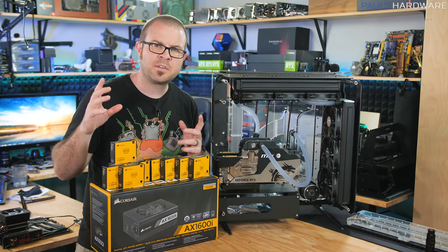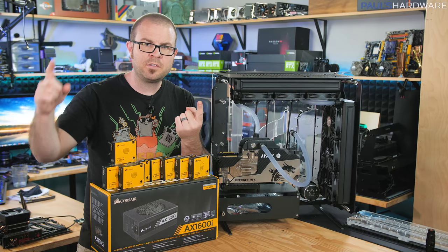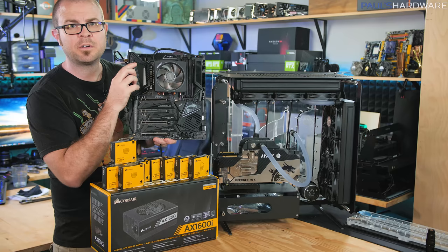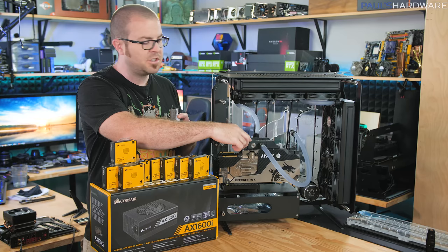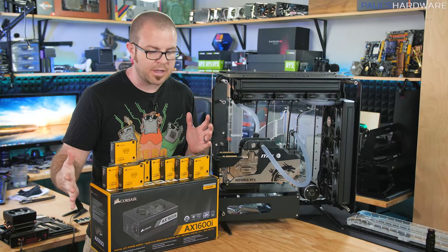Today's video is going to be a little bit different because there's some things I need to accomplish today, and then I'm going to need to come back and follow up either later this week or next week once a few things arrive. First steps today are going to be drain the temporary loop that I set up in the last video, reinstall the motherboard which is the MSI X570 Godlike, and double check the RAM clearance because with these vertical GPU mounts I might potentially have a conflict with the RAM slots on the motherboard. I'm going to try to get RGB LED RAM in there if I can.